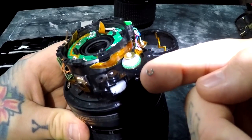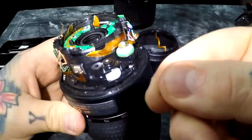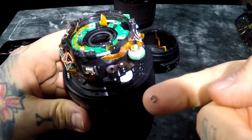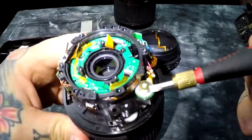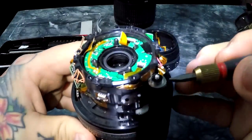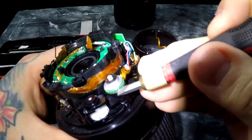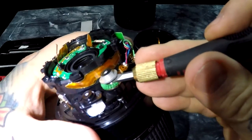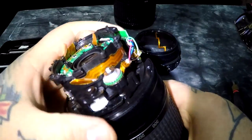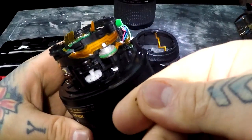This chintzy c-clip goes right here - all you have to do is drop your lens on the carpet and it doesn't take much. The thing is about three millimeters. Getting it back on is no easy task either. Once that pops off, then this pops off, and then this lifts up and nothing works anymore. If you're using the lens horizontally like a normal photographer, the lens won't drive. And this is my AFS lens - supposedly a superior motor - but it's a micro motor and the only thing it takes to fail is this little c-clip.